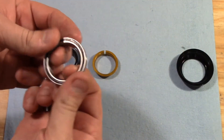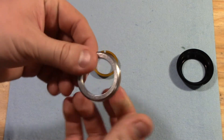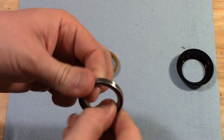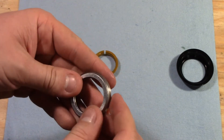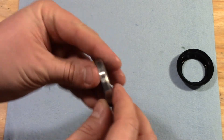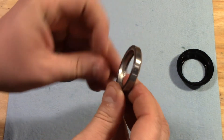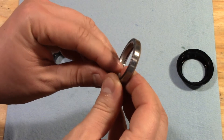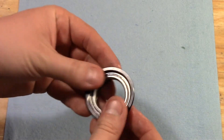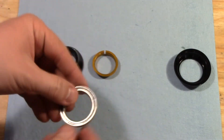The bearing is just like the one on the bottom except much smaller. This one has an inner diameter of inch and an eighth, which is standard for the upper on most bikes. This one again has an outer edge that's tapered and an inner that's tapered, on opposite sides — the outer one goes into the cup and the inner one goes up towards the handlebars.